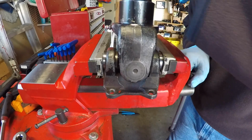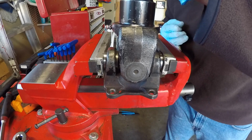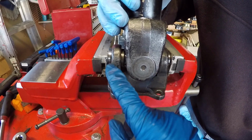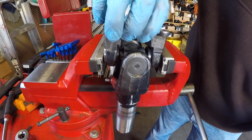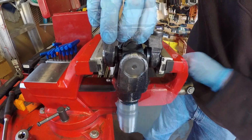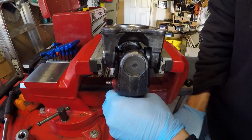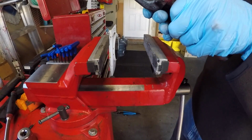Okay, we're getting a little motion from both of them, making sure that it's still free. If you tilt it the other way, you can get further, because now you're bottoming out here. So if we turn it upside down, you can get a little further. Oh, yeah, that's right. Just on to about 2/3 of the face of those bearing caps. That side's bottomed out. Yeah, so we'll stop with that. Whenever you start to encounter some force, we'll stop using the vise and go to the puller.